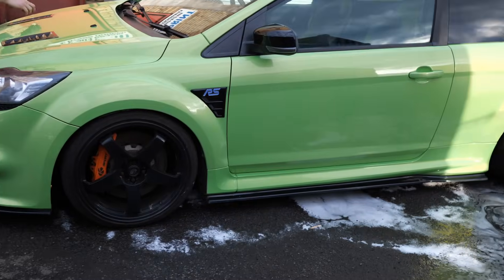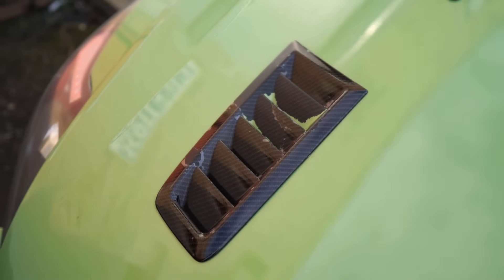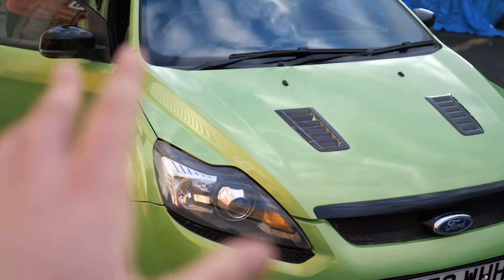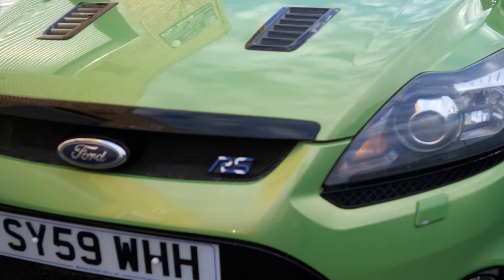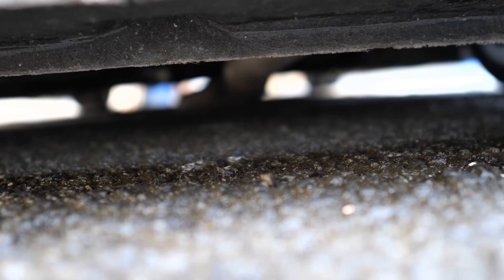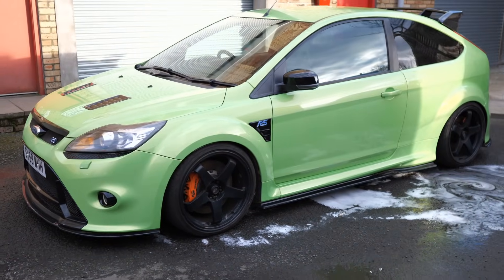It runs kind of — kind of debatable. Is that just wrap? So we've got two main problems here: the clutch is gone, so the car moves slightly. Slave cylinder's very dodgy. And if we get down low here, it's actually dropped its boost pipe off as well. So we've had to disconnect the MAF to get it running.